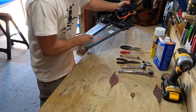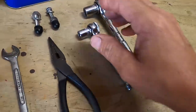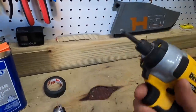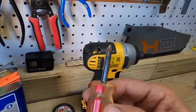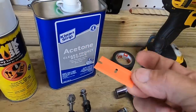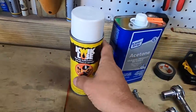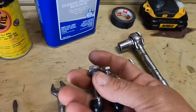So this is how I made it quieter and eliminated that. The tools I'm using today are very basic — you probably have most of these things. I have a 9/16 and a 7/16 ratchet, a couple pairs of pliers, a little 7/16 open-end wrench, a flathead screwdriver, electrical tape for a hack, a drill driver with a Phillips head on it. Over here I have acetone, which is awesome to have around the shop, plastic razor blades which are really nice to have, and some lubricating spray — this is quick lube, it comes out thick and goopy and it's really nice for lubricating your drive.